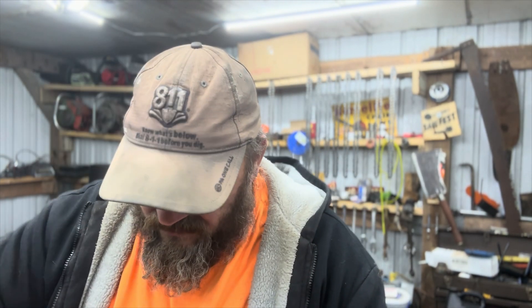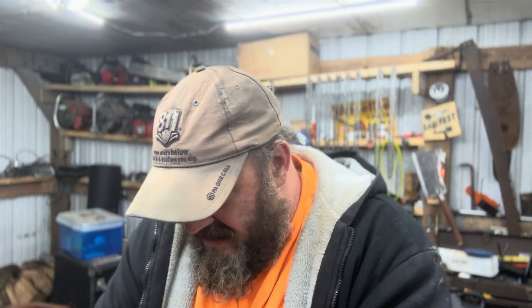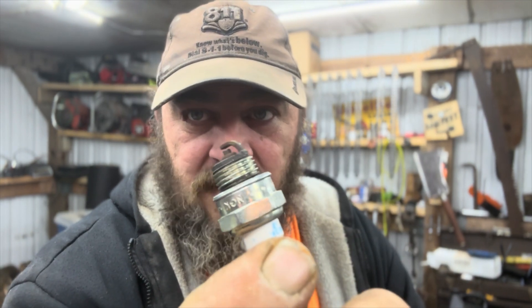I kind of think that part of my issue is actually compression. I don't think it has enough compression, which I might as well do a compression test right now and see where it's sitting. I just got a feeling it's a little lower. This is a high exhaust roof style of build — look at the tune. Let me see if I can focus that. What do you think?